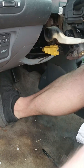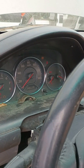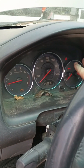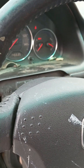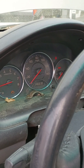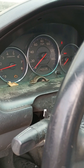All right, I've got my foot on the brake and the clutch here, got the key in. Let's watch the dash — it cranks up! We're running. There's no theft light. It does have a check engine light, but I don't know what that is — it might be because of the immobilizer being cut out. I know a lot of the Accords do it. I don't typically do an immobilizer-off, but in this situation it was needed. We'll worry about the engine light another time if they decide to fix this thing up. This job is done.